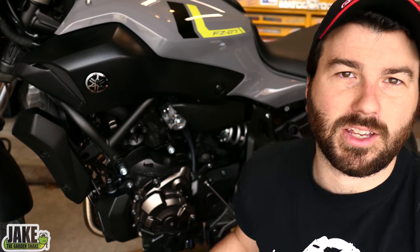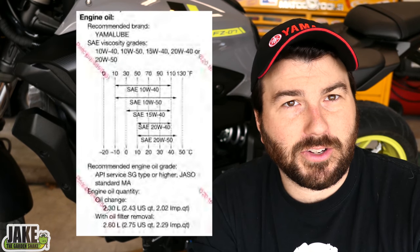You have two numbers on the bottle — the first one has a W next to it, that's its cold viscosity. It seems backwards that oil would be thinner when cold and thicker when warmed up, and normally it would be, but there's some chemical engineering going on that makes it that way. That's important because it helps get oil to all the parts of the motor quickly when you start it up. Then as the engine warms up, it comes closer to operating temperature. This is one of the big reasons it's important to let your engine warm up — your engine doesn't have the best protection when the oil's cold. As far as what weight you use, I'd say go look at what your manufacturer recommends.